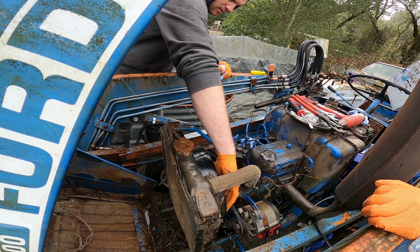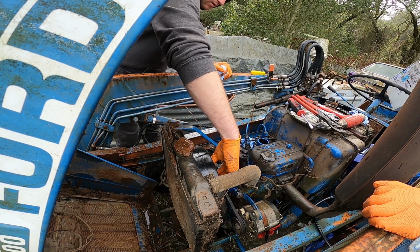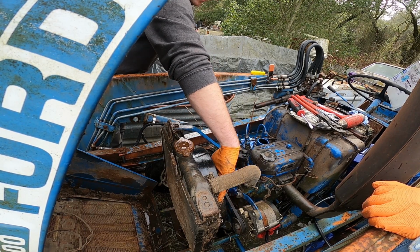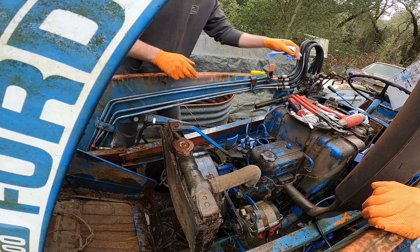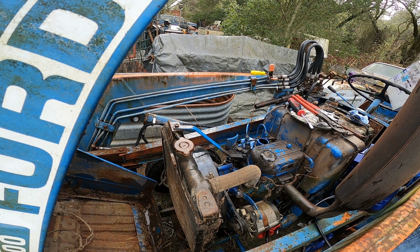I think it's engaging the solenoid. It's definitely free, it looks like. Give it a bump, yeah. Nope. Let me try to tap on this starter. Go for it. Nope. Right, let me go back to the original method, which was with the screwdriver on there. Yeah, because I think it's just engaging the Bendix gear.